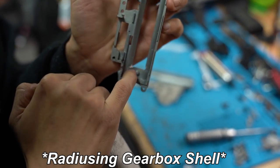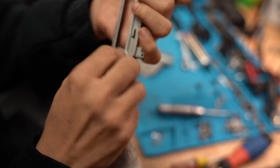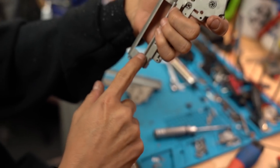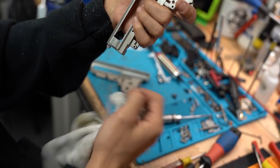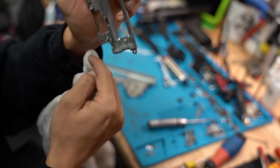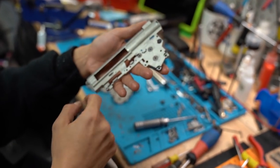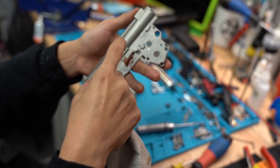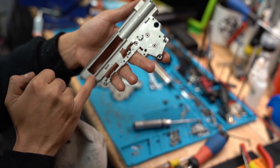So you're looking to take off those edges. You don't want to do a lot of damage on the outside. You're not looking to do these big, giant cuts. You're not looking for these to go down. You're looking more for 75% of the movement to go that way, 25% of it to go down, and ultimately just taking off these sharp corners. That's going to make it so that all the pressure that's being felt on the cylinder head, and the little bit that does get transferred to the cylinder, gets balanced on this as opposed to these hot points.